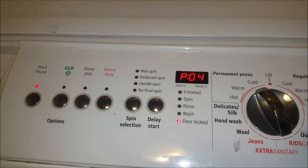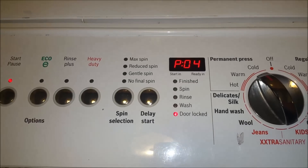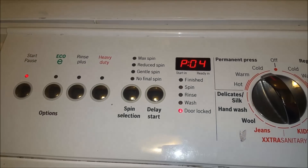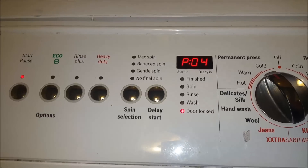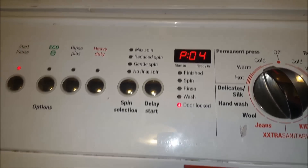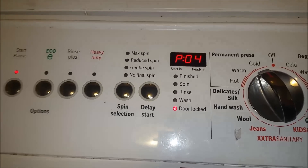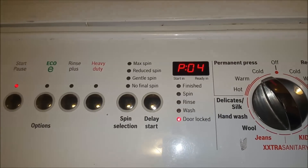You can't hear the drain pump running because it's locked up, but I can hear it humming. So what we're going to do is probably change the drain pump. We're going to have to clear out the drain and see what the pump looks like — see if there's something in it or if we need to replace it. We'll get back with you as soon as I can start draining out the washer.